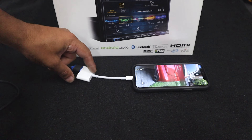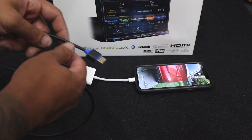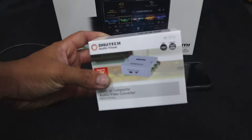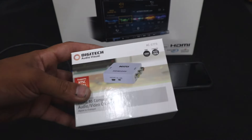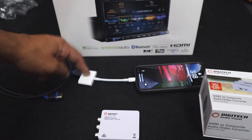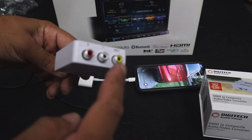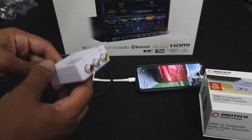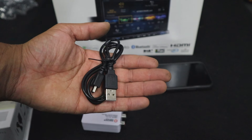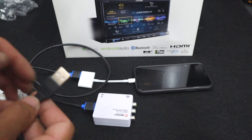To make this work we have some extra parts. To simplify: we've got the iPhone to Lightning adapter to HDMI — also has USB-C. If you've got an Android phone you can get USB-C directly to HDMI with an adapter. For a unit without HDMI input, you're going to need something like this — it's very expensive for what it is, about a hundred bucks. What it does is: we go iPhone adapter to HDMI, HDMI into this, and it converts the signal to composite or RCA. This thing does need power — it comes with a mini USB that plugs directly into the device, and on the other end you've got normal USB so you can plug that into an adapter in your car.